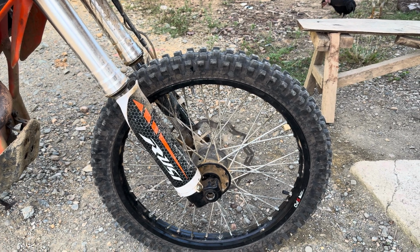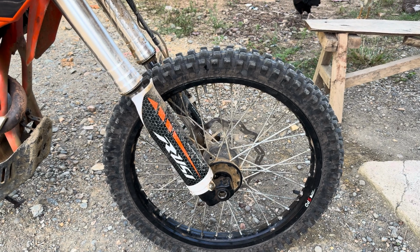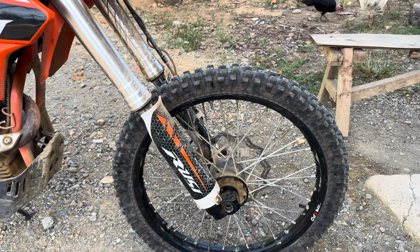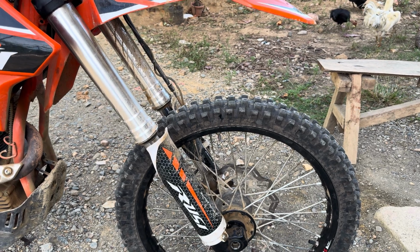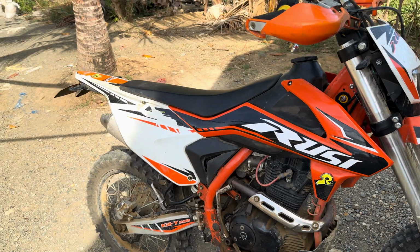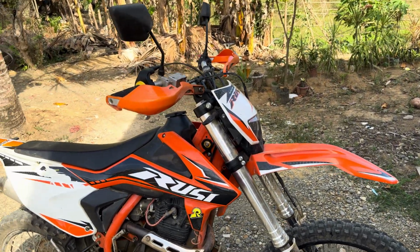I would recommend probably 8 ounces. Start there, and if you've got a really big tire, then obviously go a little bit more. I'll let you know how these plastic rim locks from China work out. I'm also going to do them to the rear, which I haven't done yet. I'm waiting on the rim locks to come,